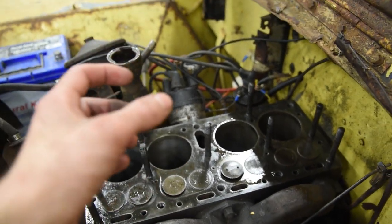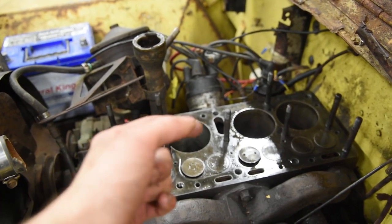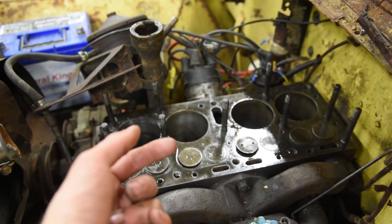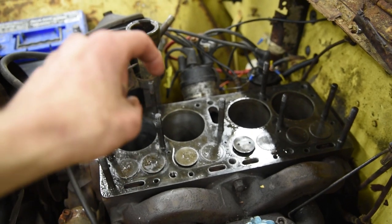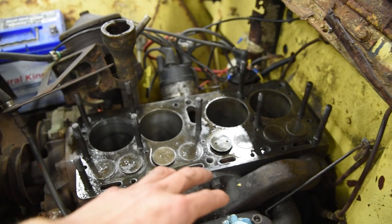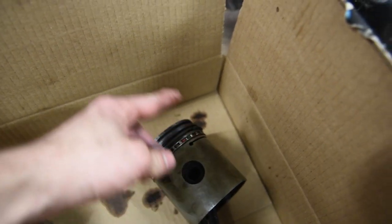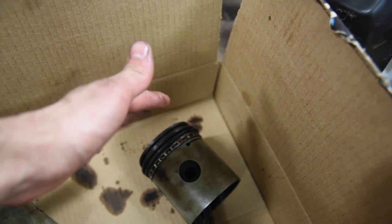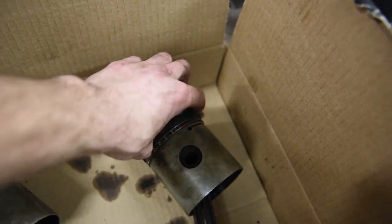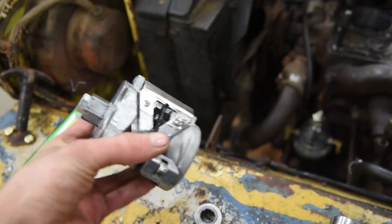When you go to pop them out, you can break piston rings, scar the piston, etc. My piston rings were broken when I took them out. However, there were pieces of rings sitting inside the oil pan when I had the oil pan off before I even screwed with this, so my rings were broken beforehand. These rings, when they hit the top of that ridge, start chattering a little bit up against the top, and you can mess up your rings and make some really bad wear. So that's why we have the almighty ridge reamer.